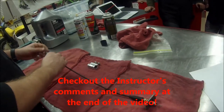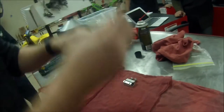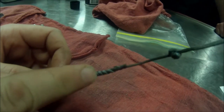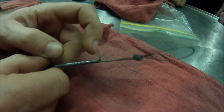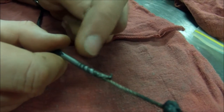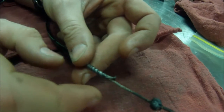We made this to operate a carburetor because the cable wasn't in any good shape, but it gives us an opportunity on video to get closer and look inside these cables. It looks like a piece of rubber, but it's actually steel wound — that's what gives it its strength, because we're going to bend around corners. There's a plastic sheathing between the cable and the steel wound, which is basically a tube — you can see it's cut here because we had to cut the cable off.